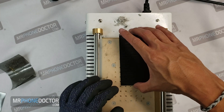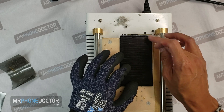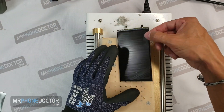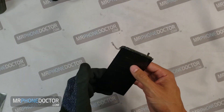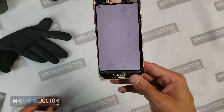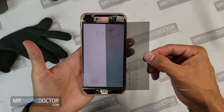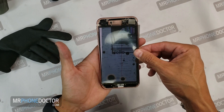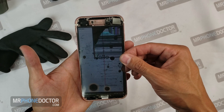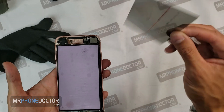Alright, so we have gone ahead and removed the polarizer layer. It does have glue on it — typically we would remove this glue, but since we are just dissecting this, I am not going to take time to remove it. I am going to boot it up just so I can show you guys how it looks once turned on without the polarizer. Wow, look at that — it looks perfect, minus the Apple logo. This is when the polarizer comes into play. You can actually see the logo when the polarizer is applied. Without the polarizer, you don't see anything, so it is very critical to have a polarizer on here.